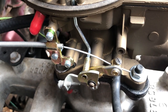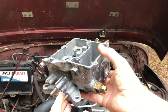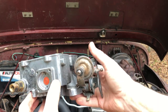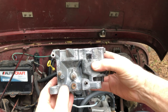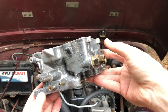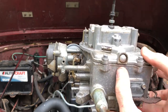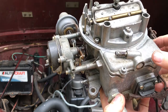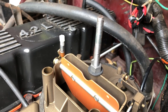Once it's all set up it works great — does exactly what I hoped it would do. This is just for reference: some people have never seen a factory manual choke 2100. This is just the base of that carburetor with the choke setup. There are no mounting brackets to attach an electric or hot air choke — from the factory those things were not on here, unlike the 2150 or a 2100 with an electric choke which would have had all that hardware.